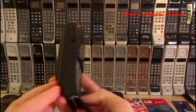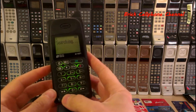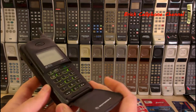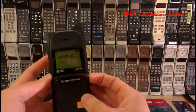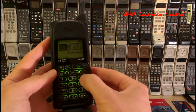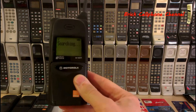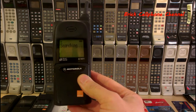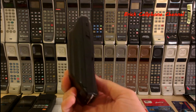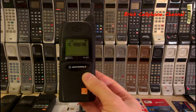Now, this phone is dual band, which means it works on GSM 900 and GSM 1800. EE works on GSM 1800, whereas Vodafone in the UK works on GSM 900. So what we need to do is change the band to 900. That should now pick up cellular service — there we go. So this one is now fully unlocked and ready for use. Thanks for watching, we'll see you next time.